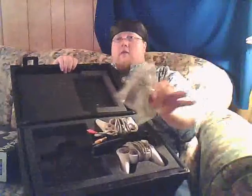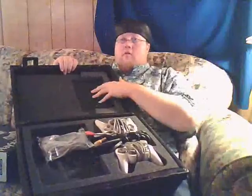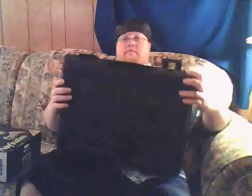I own the Blockbuster suitcase that the PlayStation 1 came in. That's where the PlayStation goes — I've got it hooked up in there, along with my link cable, turbo controllers, and the game slot. I bought this because it came with a PlayStation in it. The Model 1 PlayStation — good luck finding one in a box. I got this one in a box but it was broken; the laser lens was doing the same thing mine was doing — it wouldn't read. So I bought a new laser lens for $6 online and installed it myself. That's all you gotta do: unplug the wires, plug in the new ones, and it's a brand new PS1.